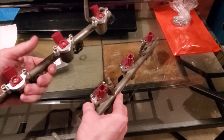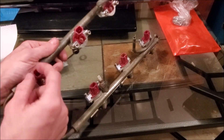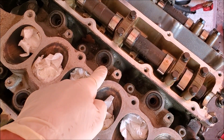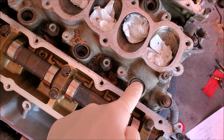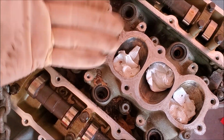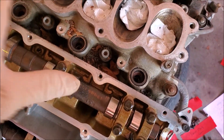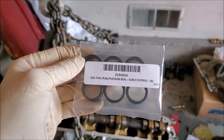The next step is splicing the wiring into the harness so we can plug and play. Back at the motor, to finish up the fuel injector swap, these are the plenum fuel rail to plenum gasket o-rings — we'll take these out, clean up that area, put in the new ones, and then drop the fuel rail in. The main thing to be worried about is all this debris — I need to clean it up before doing any of that so no debris gets into the fuel system.